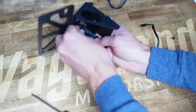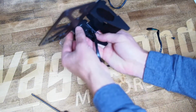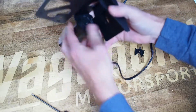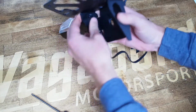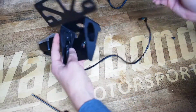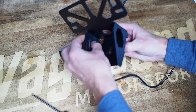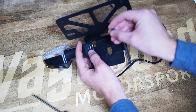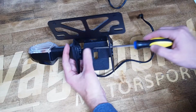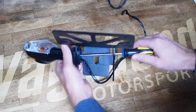Should get a good angle here. What I mean by that is you can slide it under two of the, in this case, forward teeth, hold that section down, and push in the rest of it. You should be able to feel a nice little pop or a click, and it gets fully seated under the grommeted base. At that point, you have to put that retaining plate on top of your nut plate, and if you have managed to not strip out the Phillips head screws, congratulations, reinstall them, and on one side anyways you'll get a straight shot through the turn signal hole. On the other side, go ahead and tighten up.